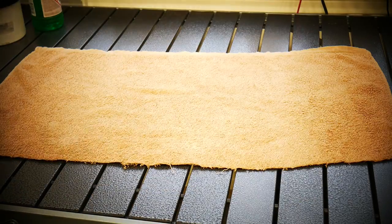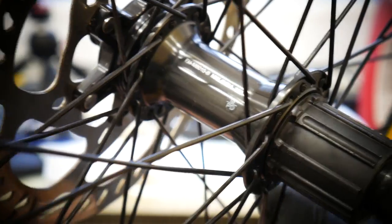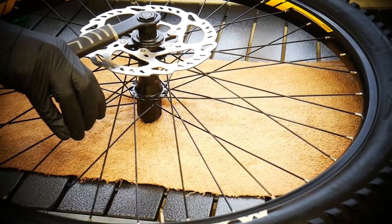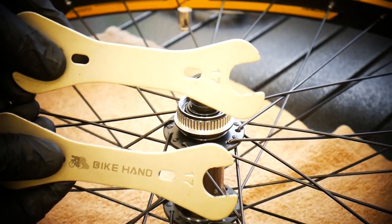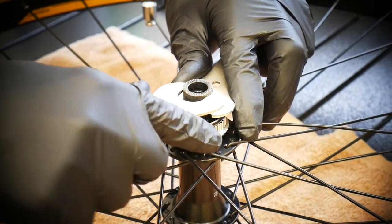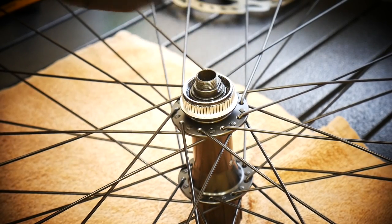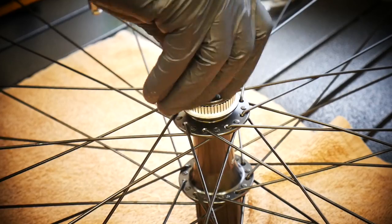Find a nice place for your job where you won't lose any of the bearing balls. This is the model — the M6010 Shimano Deore rear freehub. The difference between the hub I have and the manual Shimano provides on the internet is that they say you're going to use a 10mm Allen key, whereas I needed 15mm. We're also using 17mm wrenches to remove the axle. The whole process is in my other tutorial about bearing maintenance on this hub. I highly recommend doing the freehub and bearings at the same time, so you do the whole process just once.